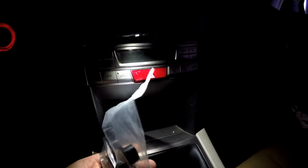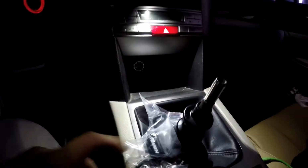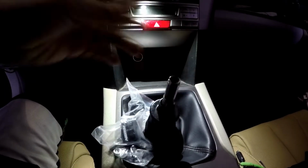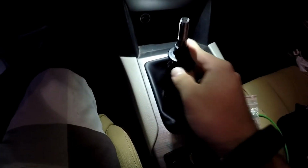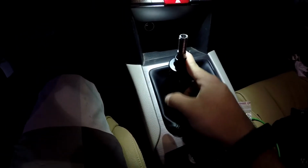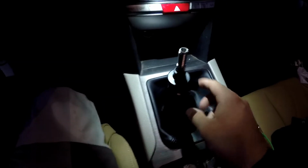2 screws, 2 washers, 2 Allen screws, and it should be pretty good to go. I think it sits somewhere like that, and it should get rid of the wiggle side to side. So this maybe, I'll get a little more light in here. So we'll just put this in first, just to see, and it is definitely a little bit less sloppy with the brass shifter bushing in it right now, but this is how it sits.